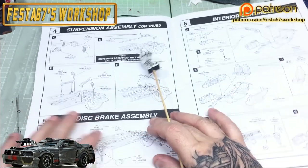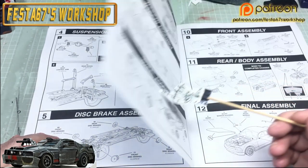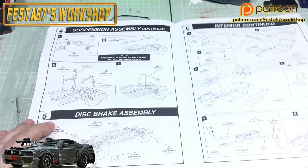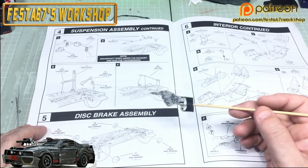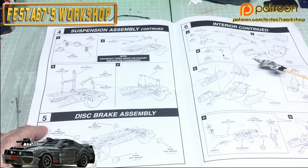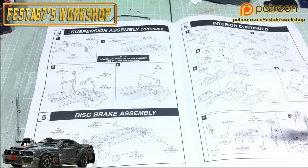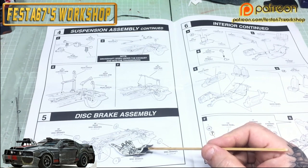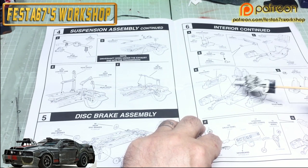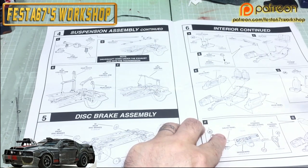It builds up pretty quickly into the car, with all interior and exterior components. We're not going to be doing a lot of that as usual. So I'm going to build in sub-assemblies — I'm going to build the complete floor pan, then do some of the interior. There's no seats going in because it's all getting chopped about. I've got armour plates to design and fab for the underside, modify the seats, lose the entire side interior, and hack the dashboard a bit.